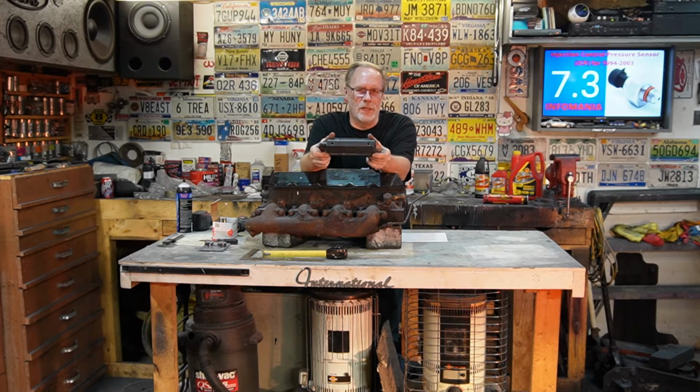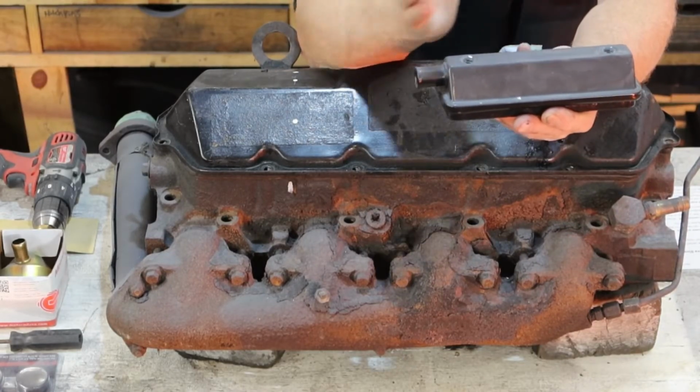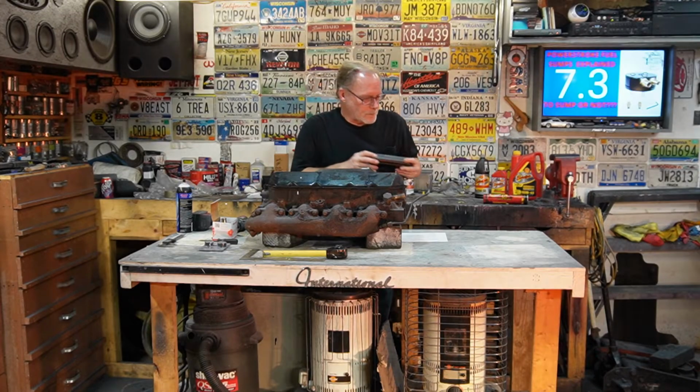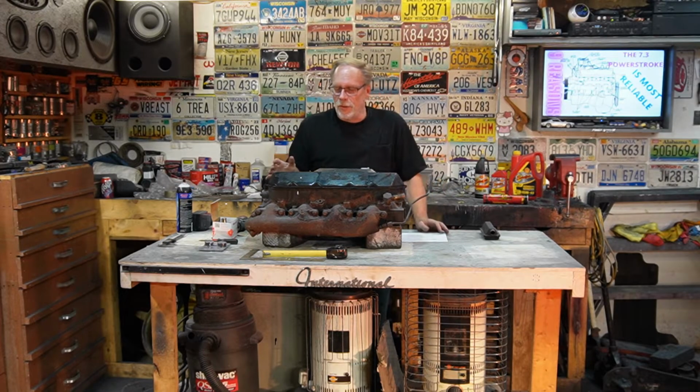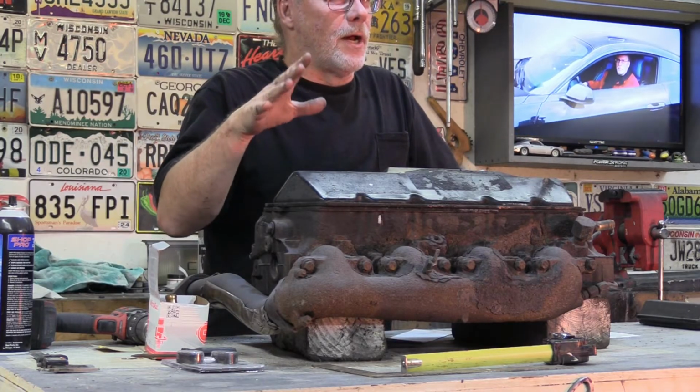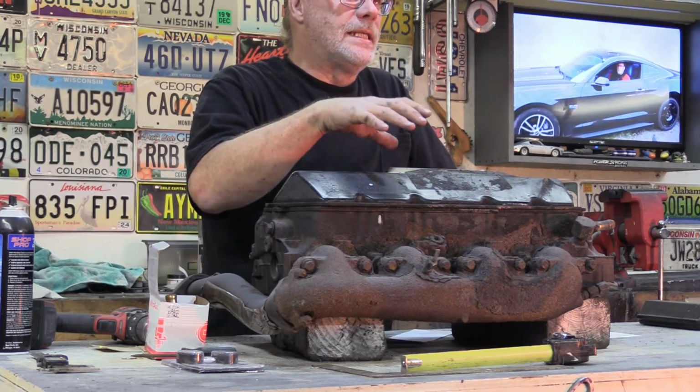The modification that I made with the CCV from the factory, I actually cut this down, and I took out almost about that much of it right there, and then I welded it together and mounted it right here. That way there was enough room for the turbo tube and any other extra items that I have on the truck. So once again, I'm going to show you how to do that. That'll be in number 4. But let's get down to putting on the extra CCV.